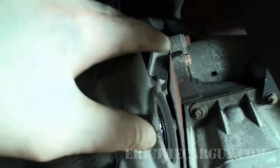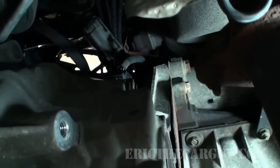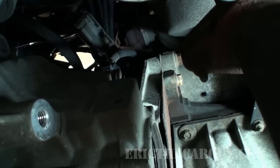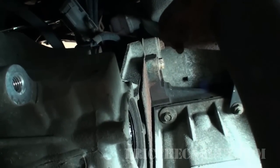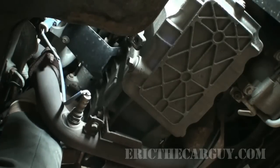Now we have this electric speed sensor to disconnect. We have 1, 2, and then there's a third fastener up there, up above. And that would be the last of our fasteners, I believe. This one here holds the starter in, and then there's one back up behind it. That's the last bell housing bolt, but I'm gonna take these out next. First, the speed sensor.